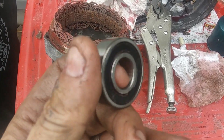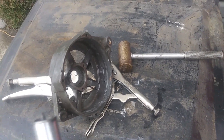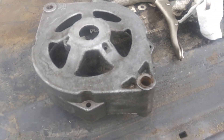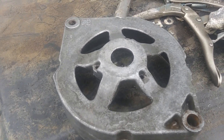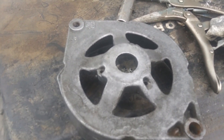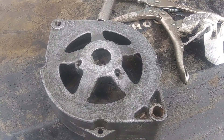Freshly packed bearing — good as new. I got that tiny one out too; that was a little tougher. That one bolt hole was broken off flush — the weld-a-nut-on trick got it out. So all the broken-off bolts are out. For the aluminum you do things a little differently with the Rust-Oleum Rust Dissolver. I washed this with soap and water — dishwashing liquid — and while it was still wet I got the Rust-Oleum Rust Dissolver on there. I used a pick to get anything heavy out of the crevices. I'll let it sit for 10 minutes, wipe and scrub it off with water, then use the heat-with-a-propane-torch-and-paint technique.